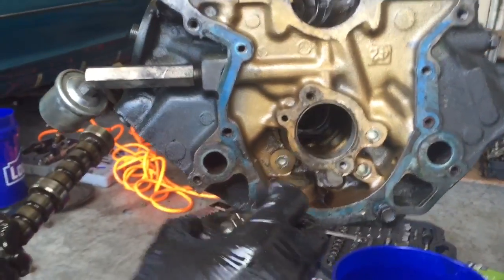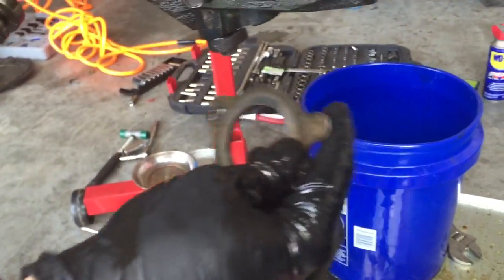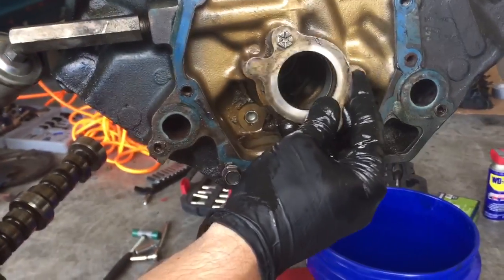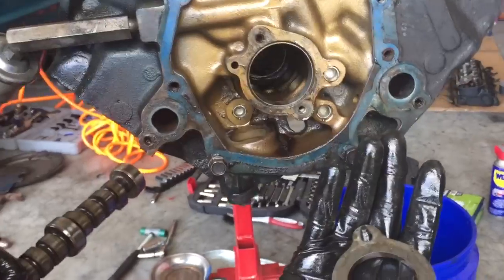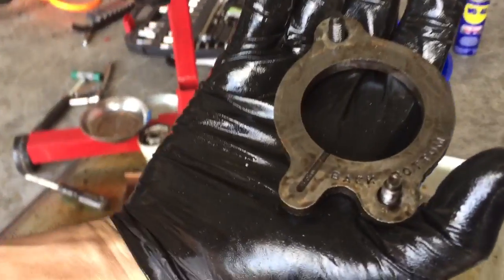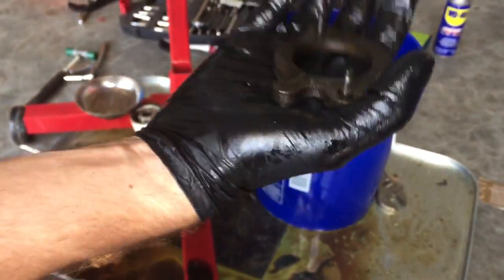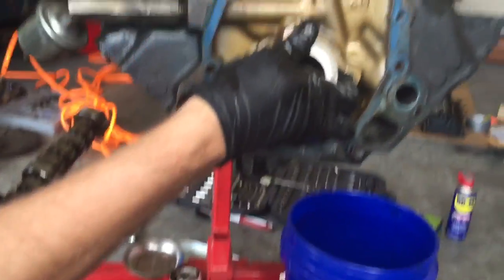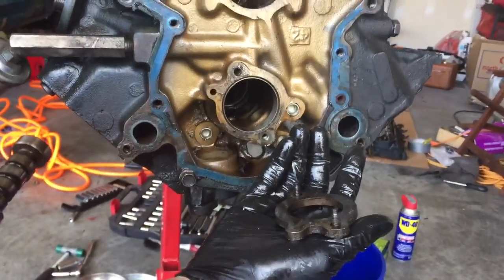Then you're going to have this as the only thing really holding in the camshaft. Now if you look at this, it goes like that back on there. And if you turn it around, spin it around, it says 'back' and 'bottom' right there. That little groove in there is an oil channel, so oil can move around. It makes sense — back and bottom — because when you put this back on and flip the engine back over, that's going to be the back and the bottom.